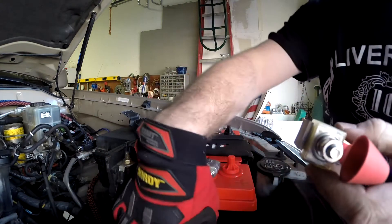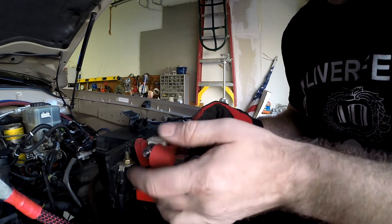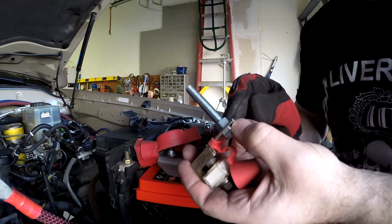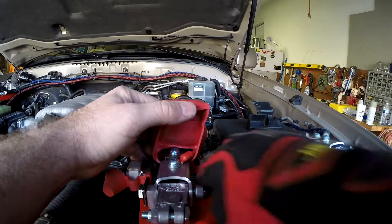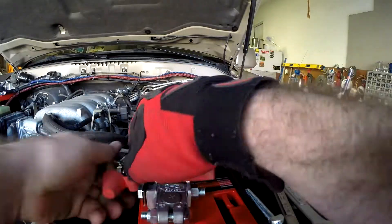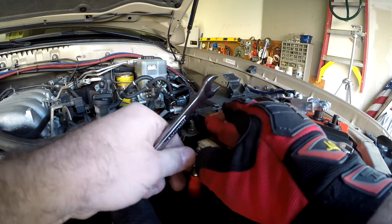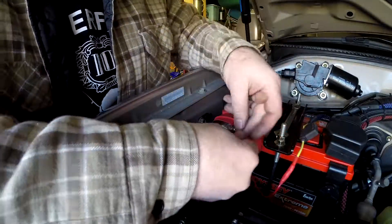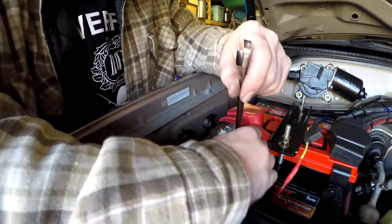I'm going to hook this guy up. I wanted to show you guys this fuse that our main wire between the batteries is going to hook up to. This was my plan to mount it on here, but the battery was in the way a little bit. What was really cool is the guy at the hardware store suggested I just get a longer bolt and put a nut on it, so that's going to hold it out just a little bit further, and then that wire is going to be able to come around and hook right on there. I like to use a little Loctite on these nuts, and always be really careful tightening these because you can easily crack the fuse body.